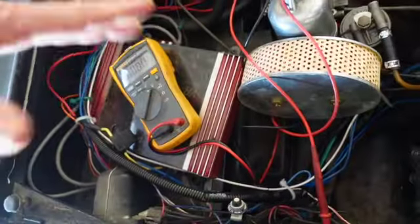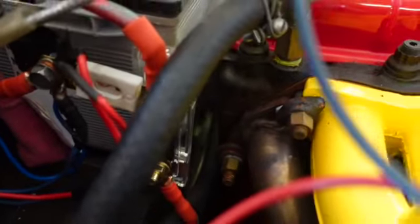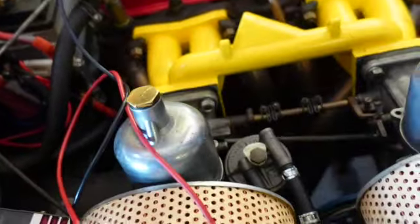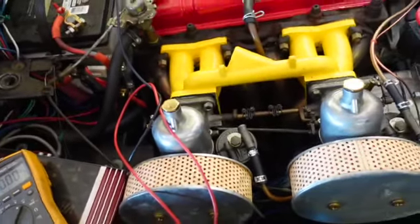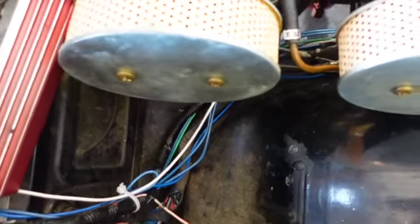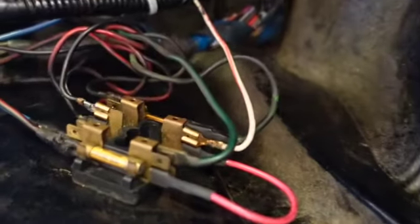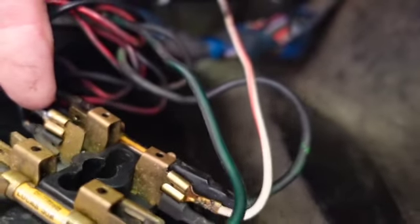Well, let me get this black wire out of here top side, and then we'll go under. I said it was going to go under, but not really so. Okay. Ooh, I smell gas. It's because I just loaded up the carburetors, the bowls. Okay, top side is pulled out, and there that is. Use that for something else. Black wire's handy on British cars because that shows that it's an earthing wire. I guess I might have been just low on wire at one point. So, and it was going to right here, which would have been fused.